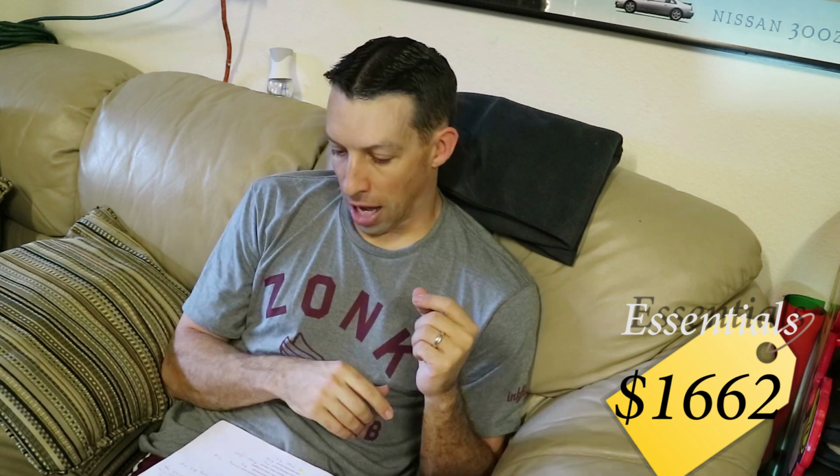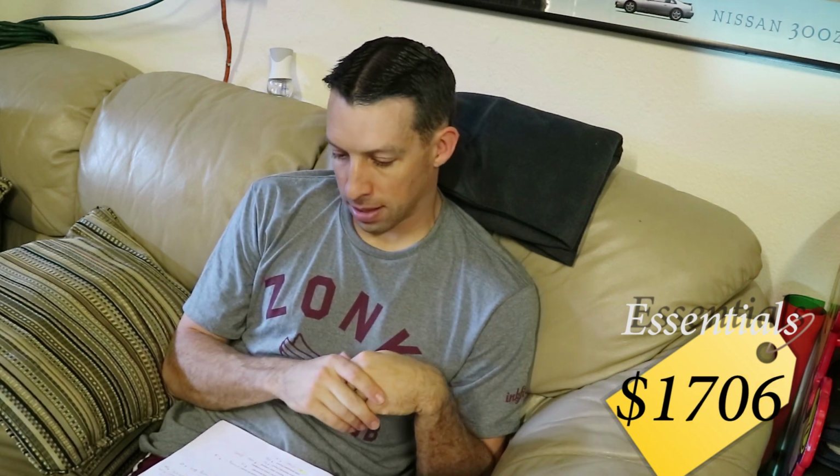One thing you're gonna definitely have to upgrade, unless you're going from a TT to a RB, 2JZ, whatever swap, you're going to have to upgrade your fuel pump. I chose to go with an OEM twin turbo 300ZX fuel pump. That was $312. In order to still be able to wash your windshield, you're going to need another windshield washer tank. The piping that you have to run for the intercooler will get in the way of the original washer tank. I paid $44 for that. In our other category, I went with a smaller battery.